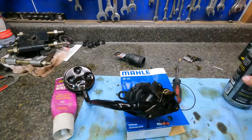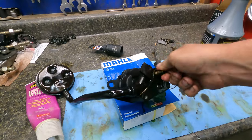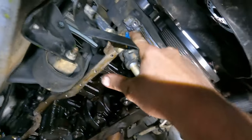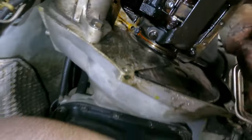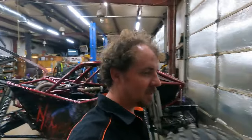One little trick: you don't have to prime the oil system on something like this. I'll fill it full of grease — the thicker the better — and that makes it real easy to pick up prime on startup. Don't forget your permatex between the timing cover and the block, and where the main caps meet the block. Felpro makes these little inserts that screw into the bigger holes and hold your oil pan gasket in place when you're putting the oil pan up. Be sure and clean the oil pan out because those pieces of piston are aluminum and they'll just keep floating around in there.